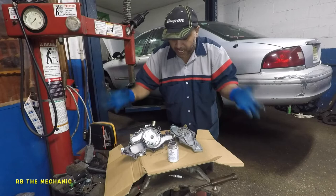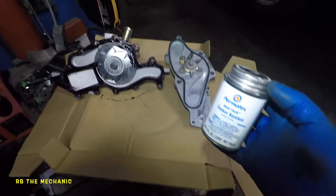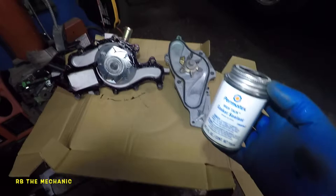After that, take the pump, put it onto the vehicle, tighten up all the bolts, and give it a good half hour or so once it's on — tighten everything and it will dry itself. Let me show you up close what this looks like. There you go — this is the sealer you want to pick up. It's a reddish color and it will save you a big headache. The part number and everything is there for you guys. Anyway, thank you for watching.